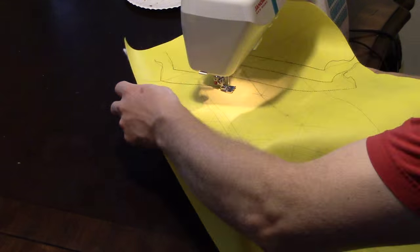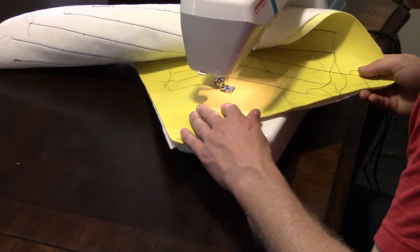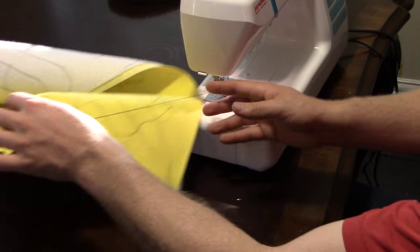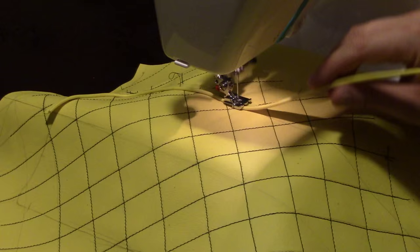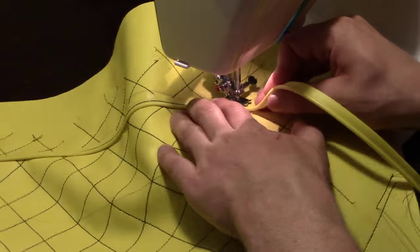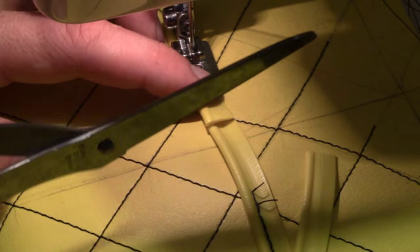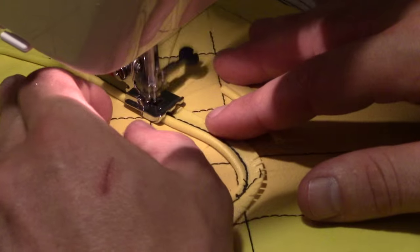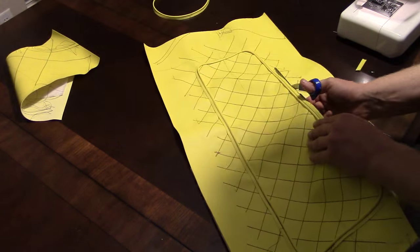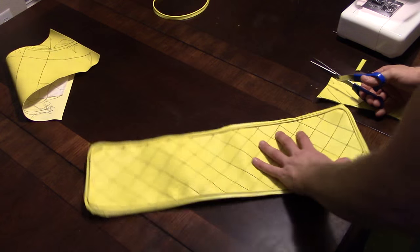Now we're back at it. Put it on a 45-degree angle from the center line, and I'm just sewing lines over the top part of the vinyl and scrim. That's what the pattern looks like — it's a slight pillow-top effect. Then I'm using welting or piping — it's known as piping or welting, this is just vinyl piping. I got all this stuff off eBay and it's pretty cheap. That's the border from where the top will transition to the sides of the seat. I'm making sure to cut off just enough so I can sew some more on the edges.